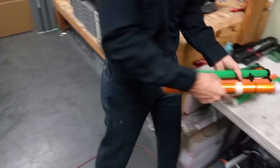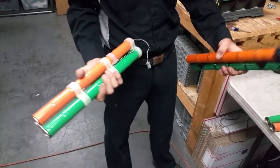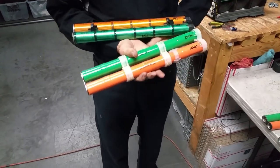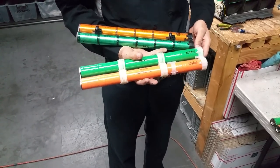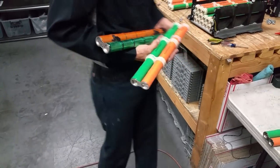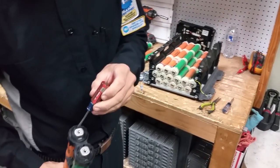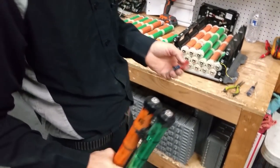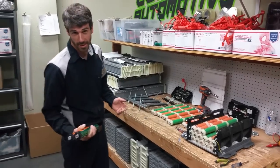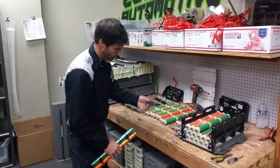Here are some that have been switched already. Straight out of your package, most likely you're going to have these batteries — the orange and the green. These are some newer batteries of better quality that last a lot longer. You'll notice these plastic pieces are not on them — they're actually different designs. So we're going to switch these two pieces and take these covers off and switch out the temperature sensors. The right way to get these off is to pry in these little spots and pull out the clips, but it's a pain. So we bought a special tool to remove these, and it's right here. Put it at the edge of the bench, kind of pop that side off, that side off — that's it.